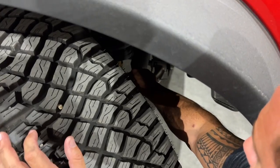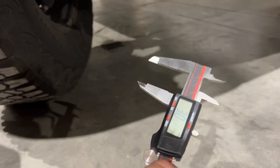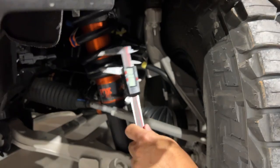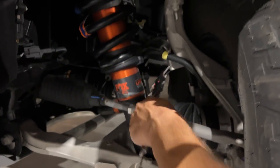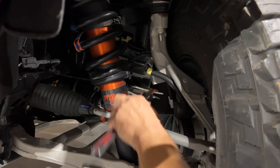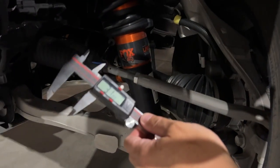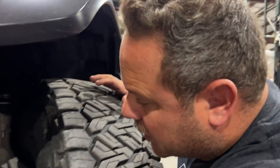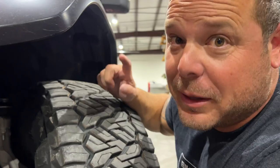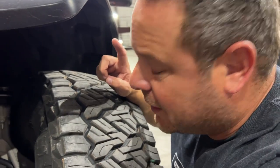Let's move on to the axle shafts — there's no way to really film in there. On the Wildtrak Sasquatch the axle shaft measures 30.53 millimeters. On the Raptor it comes in at 31.06 millimeters — again, about a millimeter difference. A millimeter difference, but it's definitely bigger. It looks bigger, and a millimeter seems to be visually more than you'd expect.